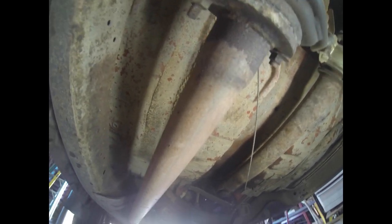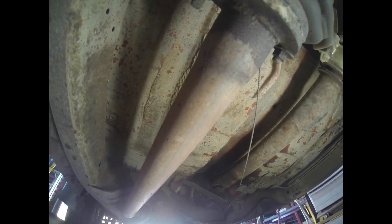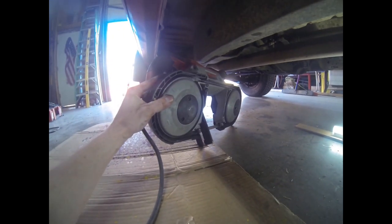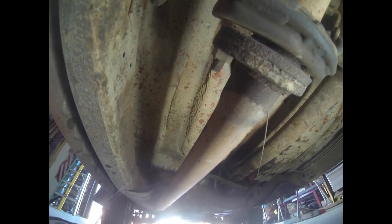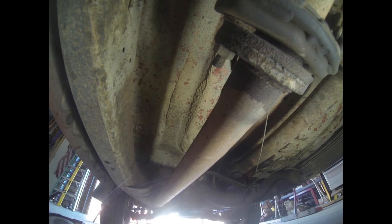So instead of messing with all that, I'm gonna take my favorite universal wrench here, and we're just gonna slice this somewhere in this big open area, wherever it'll fit. I've already got the manifold unbolted, so I think once we do that, I can slide it off up there and kind of snake this long section out. We can move on. Oh yeah, perfect.